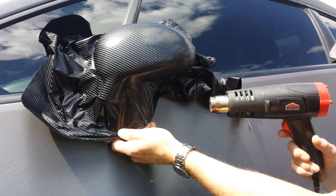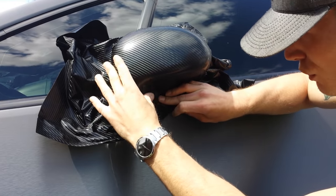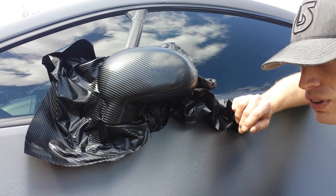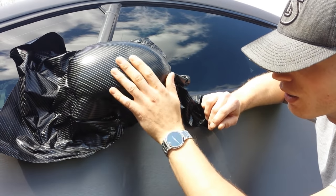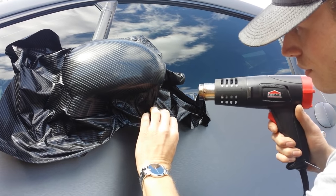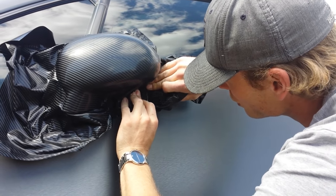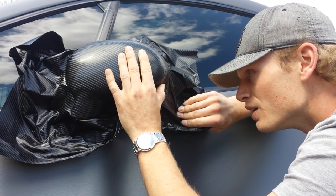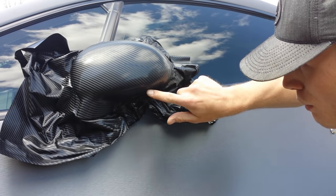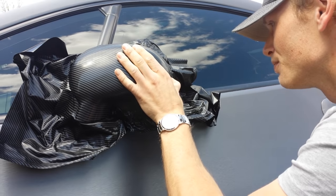I've done the mirrors on my car 5-6 times, I've done these mirrors enough times to know how they work. I'm just stretching it nicely in there — not too much stretch, just a little bit. The vinyl can withstand about 20% stretch without needing a post heat; after 20% you're going to need a post heat. I'm going to post heat it everywhere all around this entire mirror anyway — I always like to have a structurally sound install. Get rid of all the wrinkles. Even if you have to trim a little bit higher afterwards, make sure you get those wrinkles all out of there — that'll be the demise of your mirror.